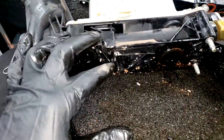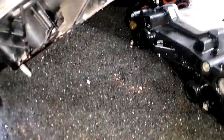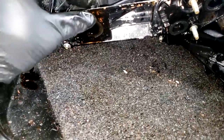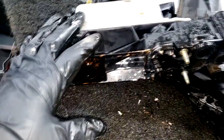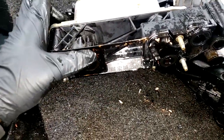Guys, what I'm going to do here — I'm trying to save $300. I have an O-ring kit, a repair kit. I'm thinking the only reason it's leaking is because these seals — first of all, all these seals are flat, extremely flat. This cooler does not appear to leak. If you're going to reuse this, make sure you do a good visual inspection. Now, this is my own personal car. I'm not sure I would take this chance on a customer car, but I'm literally trying to save $300 and going with an O-ring kit.